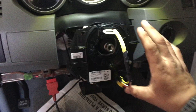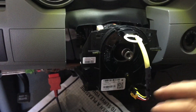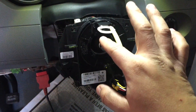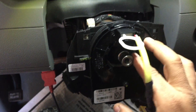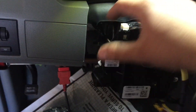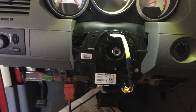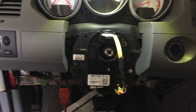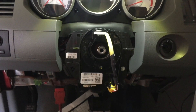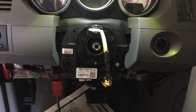Here it is — the new one's on. This is the little guide I was telling you about that keeps you from turning it so you can get everything situated and bolted on. Then we can get the steering wheel on, tighten up the bolts all around, put the turn signal switch on with its connectors, and get the airbag back on. Like I said, nine times out of ten you're probably going to need to reprogram the steering wheel angle sensor — I do have a scanner for it. That's about the only thing you won't be able to do at home without a capable scanner. Hope it helps somebody; if you liked the video, give it a thumbs up and don't forget to subscribe — thanks guys!